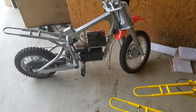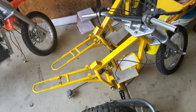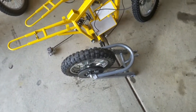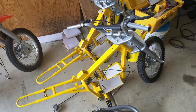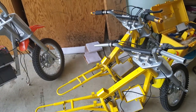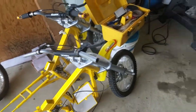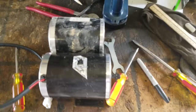We're starting the conversions, just tearing this bike apart. Our suggestion — and what's working out for us — is to completely remove the triangle on the back end. The reason being is if you decide to take these bikes from a 36 to 48 volt system, the 48 volts requires a much bigger motor.